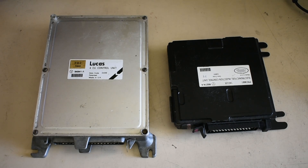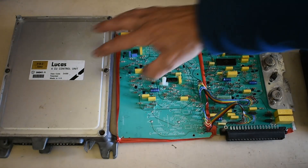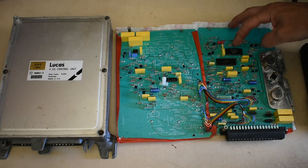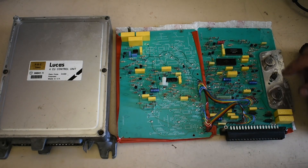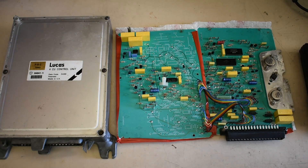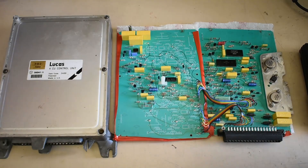If I look inside the earlier system, you open up and there are two boards sandwiched inside this unit, populated with the kind of state logic. These two transistors drive the two banks of injectors, on a heatsink which is actually onto the casing of the box.